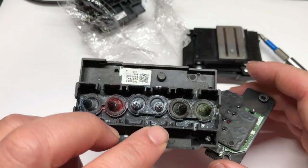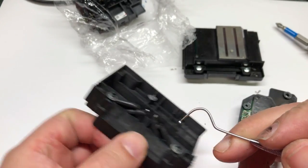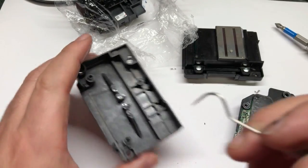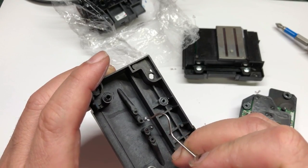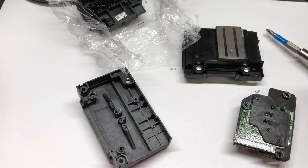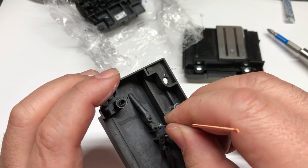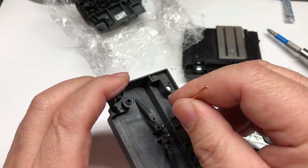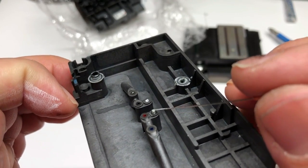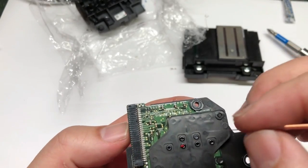You can see we have a top ink intake plate. The ink comes in and goes through those tubes. You can see the white DTF ink here. Different brands and types of ink are different — this ink dries to a powder, while some ink dries into a rubbery substance, which is harder to unclog. I take off a needle and poke inside to check the texture. If you follow other YouTube videos and just get a syringe and push it in, you're making things worse — you're pushing material inside into the printhead, which will permanently clog it.